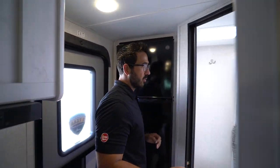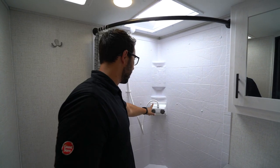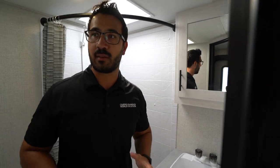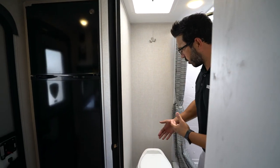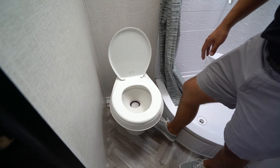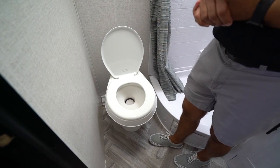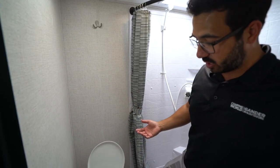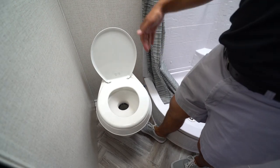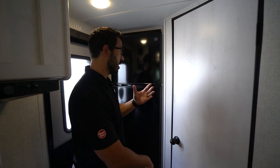Let's take a look at the bathroom real quick. For your shower, your hand wand will have a place — this is how it sits in the bracket — hot and cold water. Obviously you know how to operate a sink. The toilet, if you're new to RVing, may be a little bit different. It has a foot flush lever. The way that basically works is if you push and hold it just for a second — just a little bit of pressure — that will allow water to fill up the bowl. If you need a little more water in the bowl, that's what you're going to do. Then to flush it, you're going to push it all the way down to the floor, which just opens it up — it's a straight drop into the tank. RV toilets don't have a P-trap like your residential toilets do, so when you flush, if you smell a little bit of sewer gas come up, that's completely normal because it's just a straight drop into the black tank.